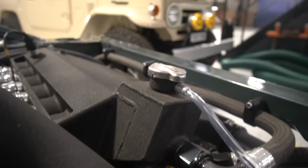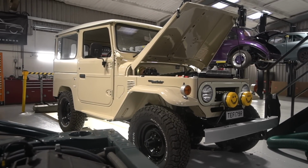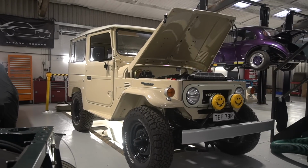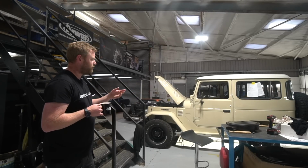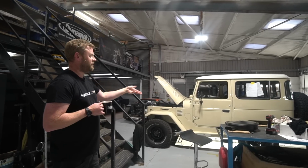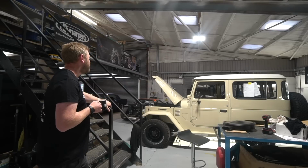Land Cruiser, obviously last week, big cheers as we discovered the source of the dreaded squeak on it. Moving on from that, I'm struggling to think what we have been on with this. Oh, I remember. We're obviously waiting for the revised Viton lined hose for the fuel fill setup. But we decided as a sort of belt and braces, we're also going to put a vent in the bottom of the fuel tank enclosure to the underside of the car. There was a small vent hole in there, but we've decided to put a bigger hole in there and then make a little fabricated shield over it, so that the air rushing under the car creates a sort of negative pressure to pull any fumes out of that tank. And also stops any rain and road spray, etc., going up through the hole.